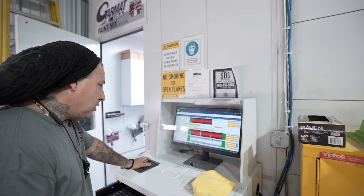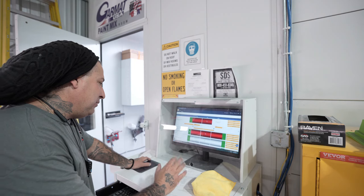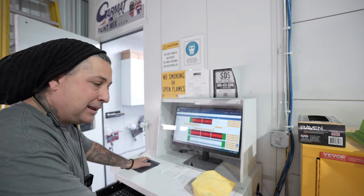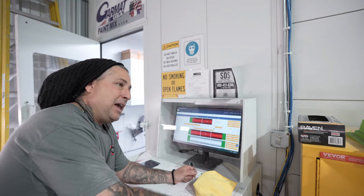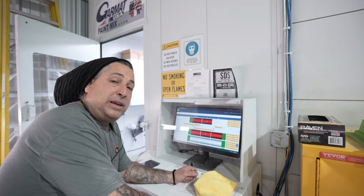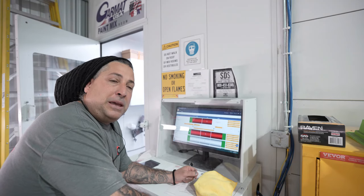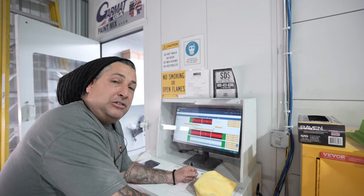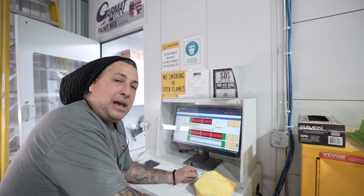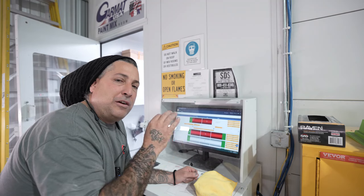So I was talking with Pat and he told me, if you have anything that is in the 90 range, do not go with the adjusted, because sometimes that camera will over adjust it and it'll get it way out of the ballpark. And I did have that come up last week when I was doing one. So I was shooting code 300 for a BMW and I went with the adjusted, even though I had a 90 something on my regular shot. And I started spraying that thing and checking the color, and that color was very, very blue.